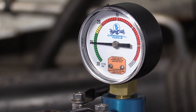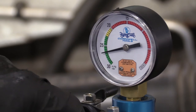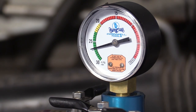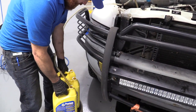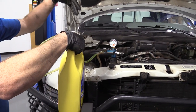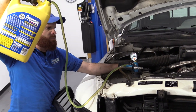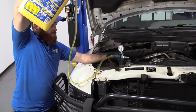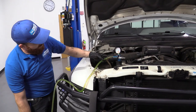Here's our 25 — we're going to keep going until the needle stops. All right, that's just about it right there. We'll close this off, turn off our air, and now we can get our coolant ready. When we come back in approximately five to ten minutes, we're going to make sure that this needle has not dropped below the 25 mark. It's been holding for a good five to ten minutes, so I'm going to grab our coolant. We've got our hose down in there and we're going to let the vacuum fill the system. We're on gallon number three — we don't have as much negative pressure in there to create vacuum anymore, so I'll hold it up high, and that is it.